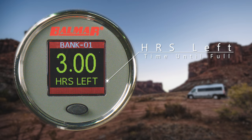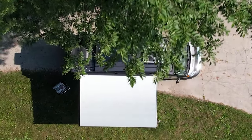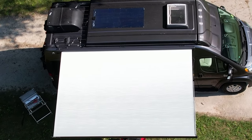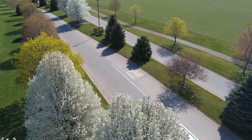So to get these batteries charging, run your van like we are doing now, or plug it into the 30 amp shore power. And how about some bonus charging? Because you have a solar panel on the roof, when you are in full sunlight, that panel can produce about 9 amps of charging, which keeps those batteries healthy when not in use or when you are using just a few 12 volt lights.